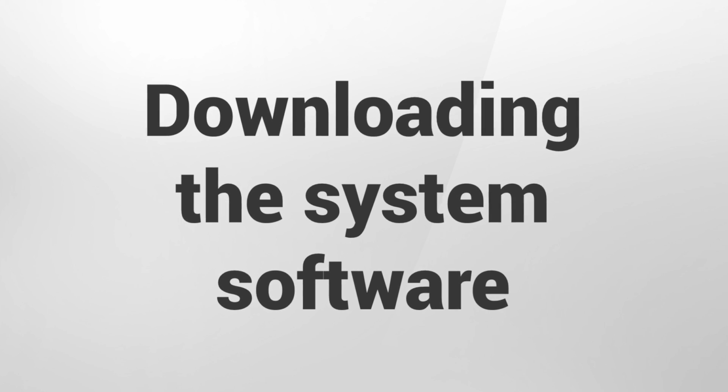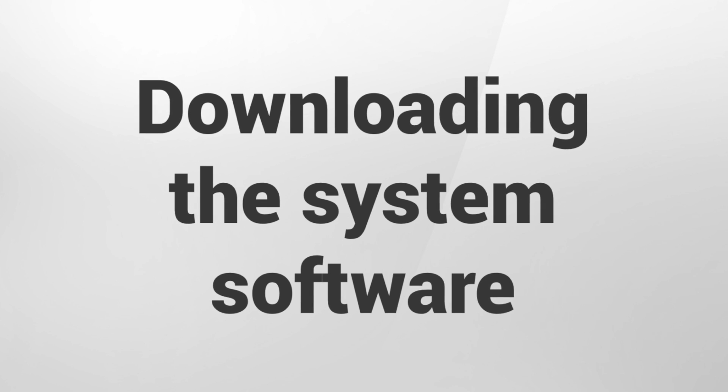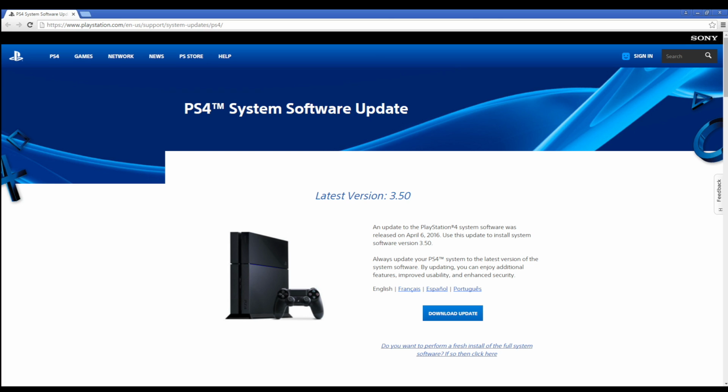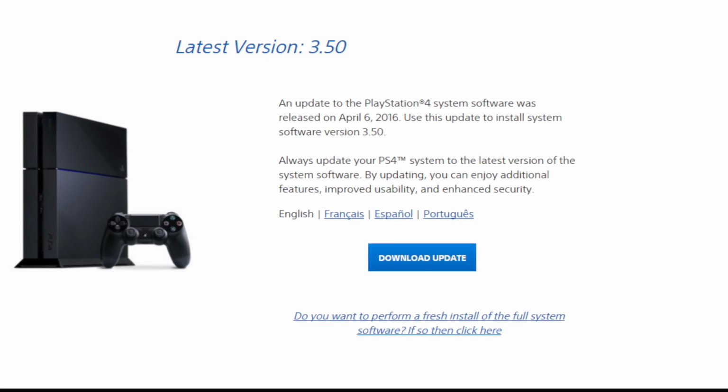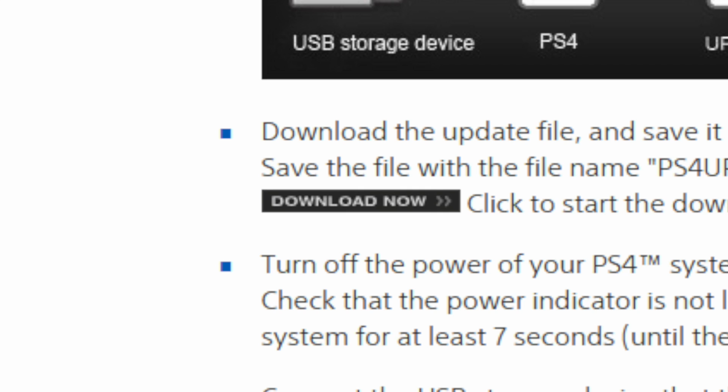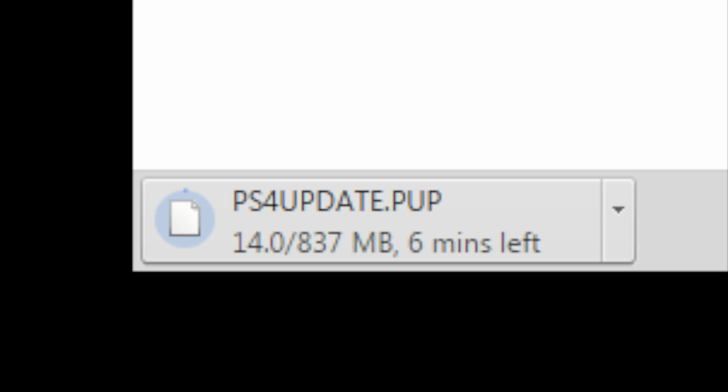In this step, we will download the system software required to complete the hard drive update process. Start by plugging the USB flash drive into your computer. Open a web browser and go to the following page on Sony's website. You can click the link below or find it in the information section of this video. Once you've reached this page, click the link labeled, "Do you want to perform a fresh install of the full system software? If so, then click here." From there, click the Download Now button, which will initiate the download of the system software. Make sure to verify that the file is labeled ps4update.pup and that the file is around 800 to 900 megabytes in size.